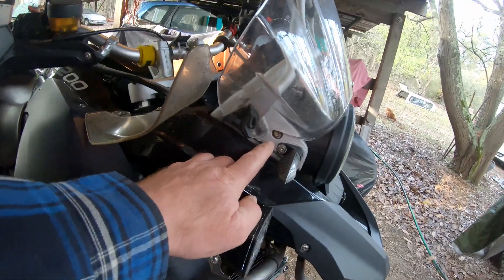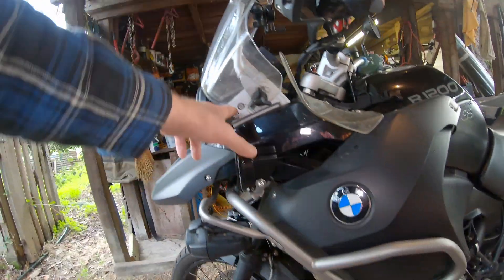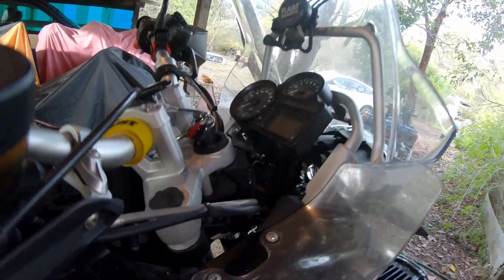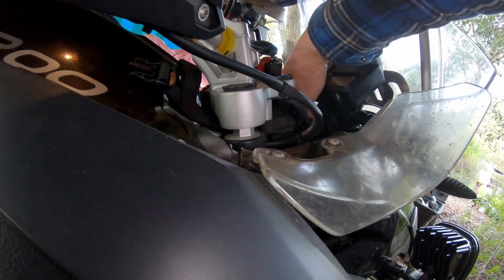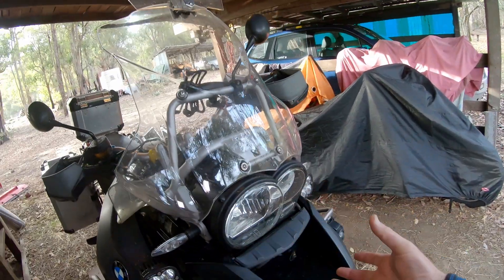What I'm going to do is — there's a torx screw here and there's a matching one on the other side, so I can take those two screws out. Then up under the dash here there are about three plugs that need to come out, and then I can slide this whole headlight arrangement out forwards and gain much better access to the back. Hopefully that's a nice easy fix. There's a hack I found online to replace the clip retainer, so we'll go through that.